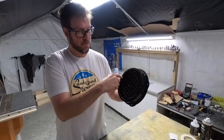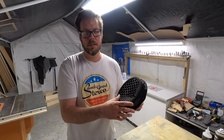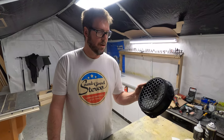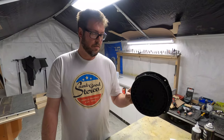So the sound from the front of the driver comes out of the door. It doesn't play into the door panel. Yeah, we just play efficiency games. So you get a better response. You don't have weird acoustics happening with it bouncing around inside the door. And the factory does really well with that. A lot of people just negate that. So that's why it's important to replicate it.